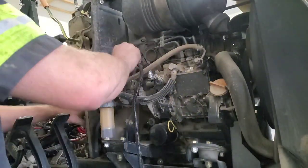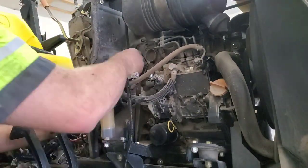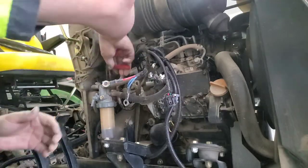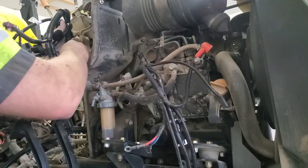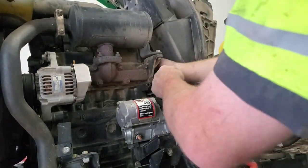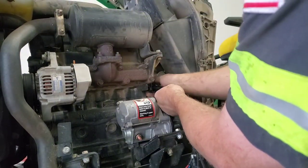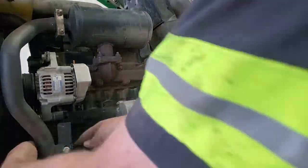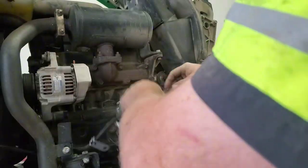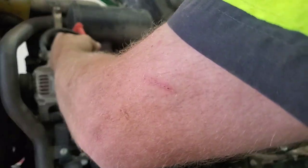From here it's kind of your personal preference. I don't like trying to remember absolutely everything of where it goes, what plugs into what, and how it's routed. It's usually best to do big chunks and leave some of it in there so you only have to remember so much at once. Once you get so much of that harness pulled through on the right-hand side, shove it across the back of the engine to cross back over to the left-hand side and pull the entire section through. That way you can lay it up into the area just above the starter along the block, up into the securement place that's hidden behind the alternator, and then start laying it into place.